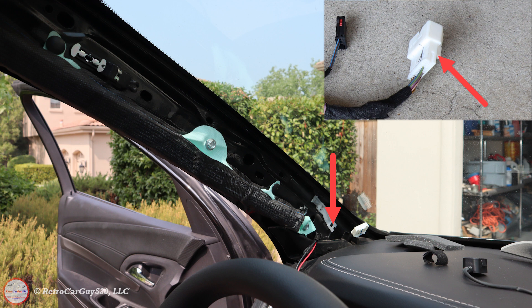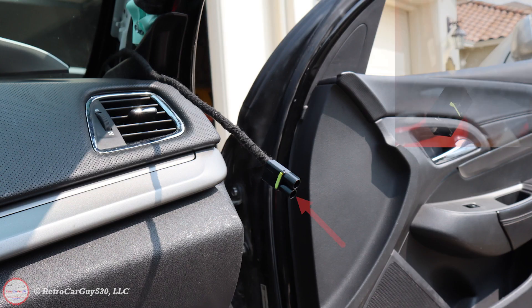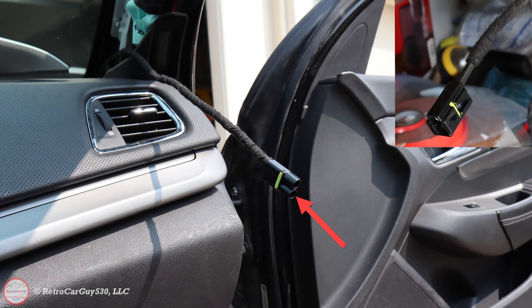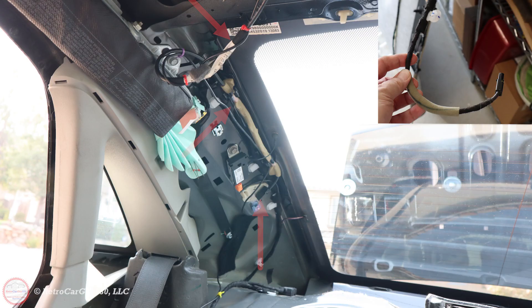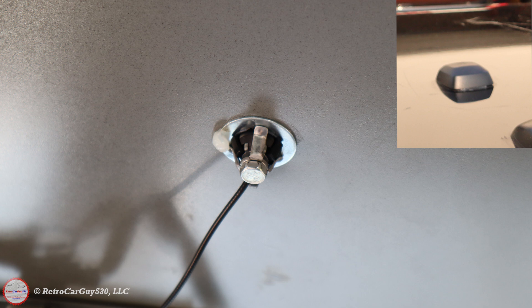The A-pillar connector on the front left is somewhat hard to get off — the underside of the actual connector from the headliner has a little plastic tab that you push out to disengage it. Then the two portions of the white electrical connector connect up pretty easily. On the front right we have the AM/FM antenna connector that needs to be connected at the A-pillar. At the C-pillar we have the same cabling, but notice there's a secondary cable running up there for my XM radio antenna that I added. Here's the bottom side of the AM/FM antenna in the center of the roof.